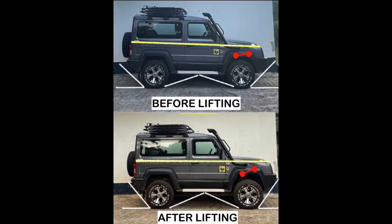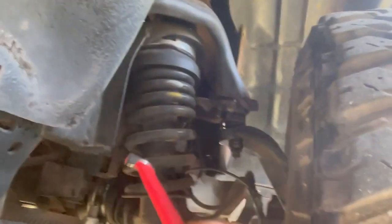Remember that the original bonnet line was raked with the nose down. At that time, the brake dive geometry was at a particular orientation and alignment was done on the stock truck based on that angle. Now, after the Blue Garage lift kit leveled out the bonnet line, the brake dive geometry orientation has also rotated along with the bonnet line. This is another reason why alignment gets difficult after lifting.